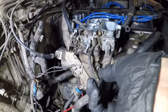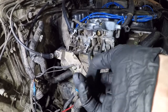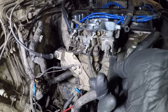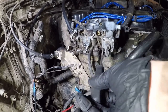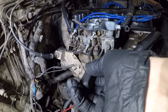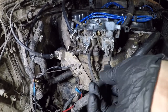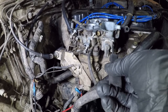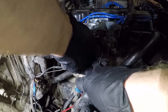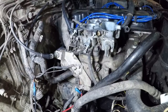These should have a little bit of tension on them because you're installing a spring, but there shouldn't be a ton of tension. So just go slow, and I like to install them in a crisscross pattern just to kind of evenly persuade that gasket and diaphragm in there. The torque spec on these is just tight enough. Remember, you've just got some little machine screws going into some weak material here, so you just want to go slow and not go too tight. Well, that should solve my actual problem that I had, so that's nice.